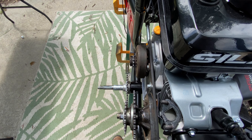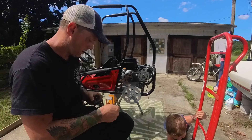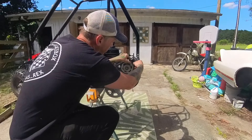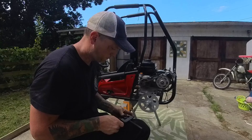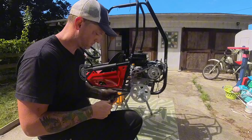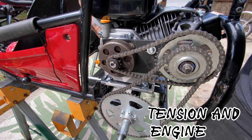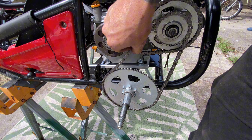Now I've got everything in place and lined up, we're going to start cutting our chain. I definitely recommend getting a go-kart racing chain over one from a tractor supply store — it'll last longer and won't stretch out as quickly. I also recommend getting a good quality chain break tool; it'll save you a lot of time and headache, especially if your kid rides as often as Silas does. All right, chains are all cut and put on — now we just slide the engine back a little bit to get some tension.